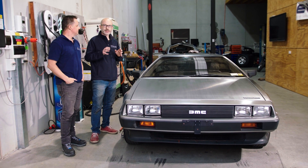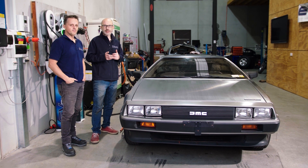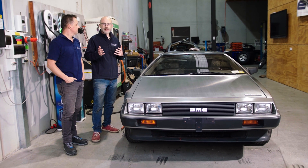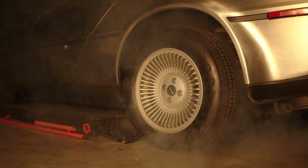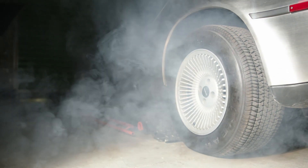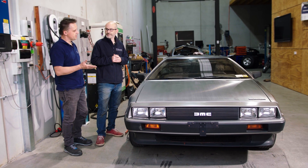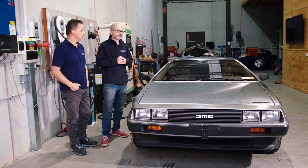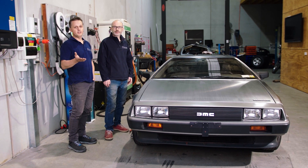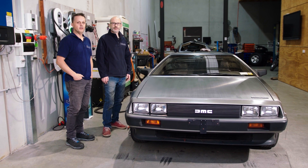The key here is it's a Tesla powertrain — a drivetrain — a small drive unit which will go in the back, and also Tesla battery packs. It's the perfect fit for this particular car. It's a rear-engined transaxle car, and the small drive unit from Tesla should fit perfectly if all the scans are true. Requirements may change along the way, as it's been done so few times around the world. Availability of parts is one thing, and the Australian engineering requirements are also quite unique in Melbourne, so we expect some adjustment along the way.